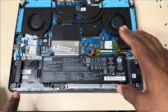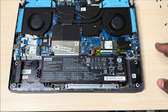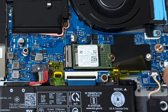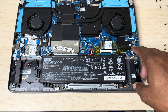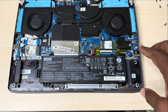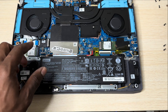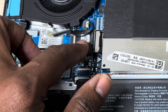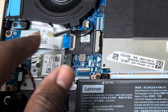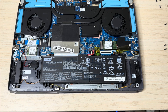What I want to show you real quick before I remove the RAM — this laptop comes with a 2242 SSD, that's it right here, 512GB storage. You can swap it if you want with a 2280 SSD up to 2TB. There's also an additional M.2 slot right here that can also be used for SSDs, so you can put one SSD here and another one in the second slot. But that's for another video.